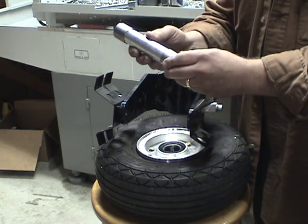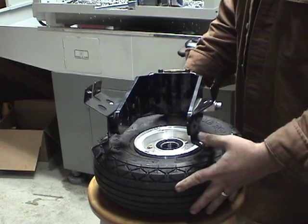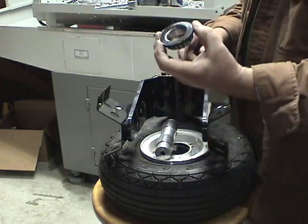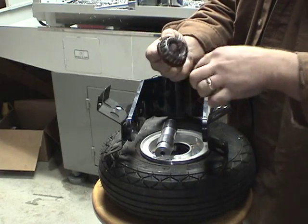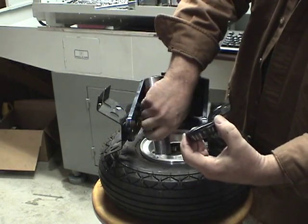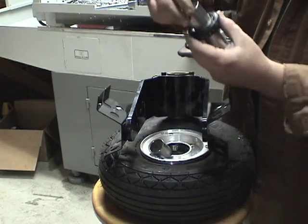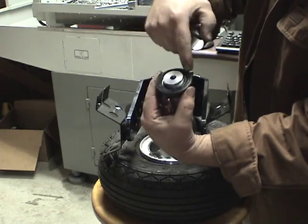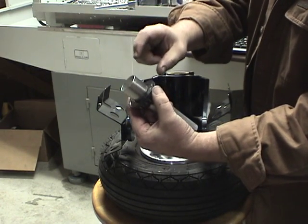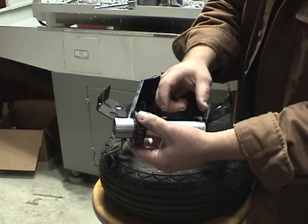Not long into production, but still the problem is the way these are designed — the bearings are not traditional bearings. These bearings have the oil seal on the outside. This whole mechanism is designed to rotate. When this axle is in the wheel, the collar pretty much just sits down in that inside radius of that bearing. Even though the larger one doesn't have a very large contact area, the compression should be between the bearing and the fork, not on the axle itself.